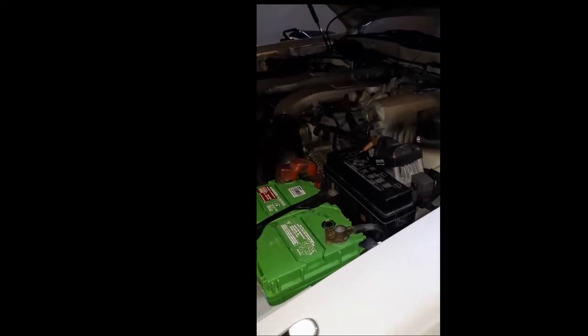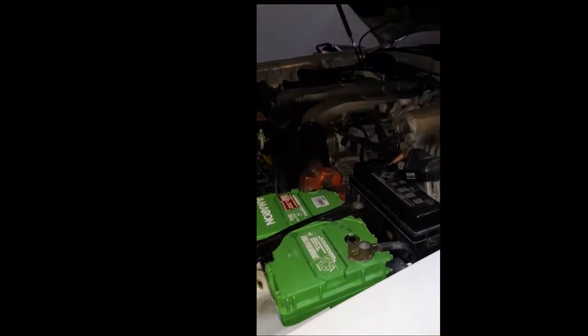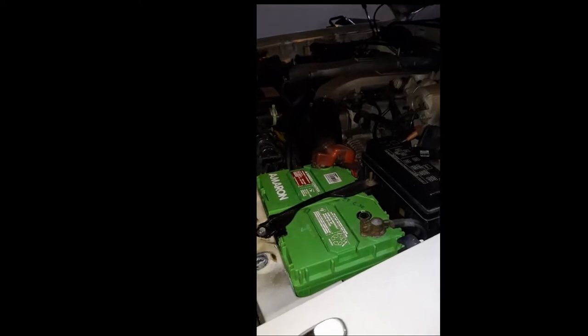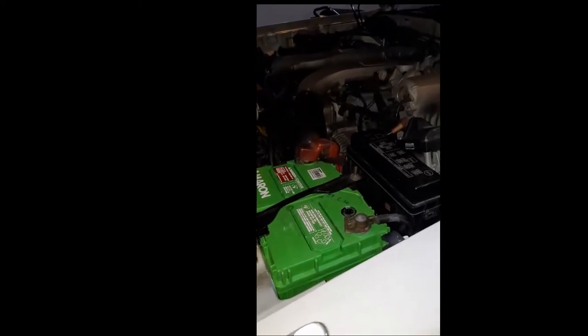Okay, so right now I'm gonna run three experiments. One is with the hood down, and just see how long the temperature takes to reach the target temperature without turning the fans on. And then next is to let the fan turn on and see how fast it cools down. And then one more, we turn off the fan and we leave the hood open and see how long it takes to get to the target temperature of 55 Celsius. Alright, so the target is, again I repeat, the same or a shorter time to cool with the hood down.